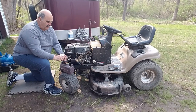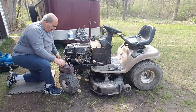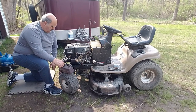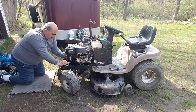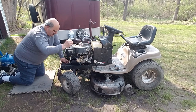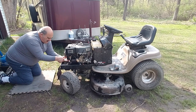It's a beautiful spring morning and I let the Permatex RTV gasket maker set overnight. I just have to connect the fuel line, put the muffler back in, put on the oil filter, and fill it with oil — and we should be good to go. I'm going to use a new exhaust manifold gasket that I ordered — it's two 13-millimeter nuts holding it on underneath. By far this is the easiest muffler and exhaust manifold I've ever taken off — virtually no rust and the bolts were fairly easy to get at. It came off and went on very easily.